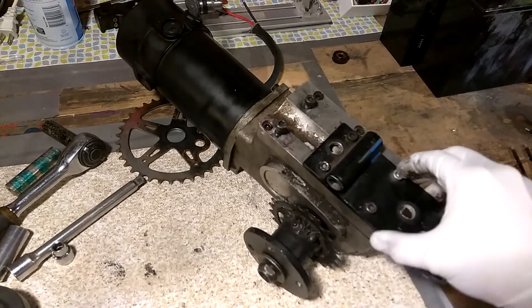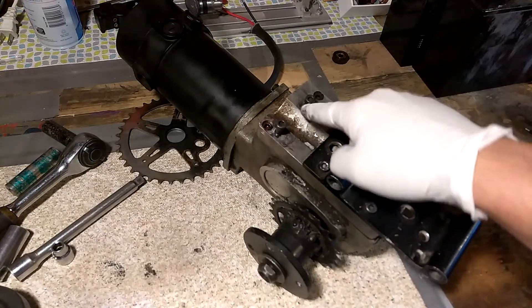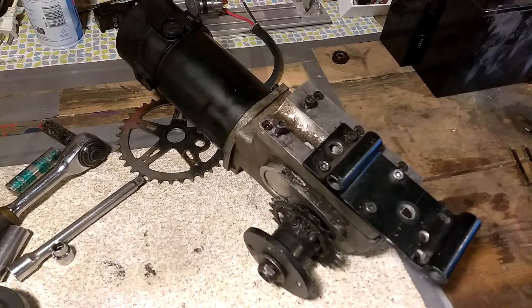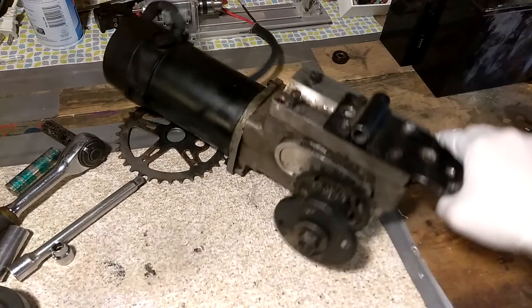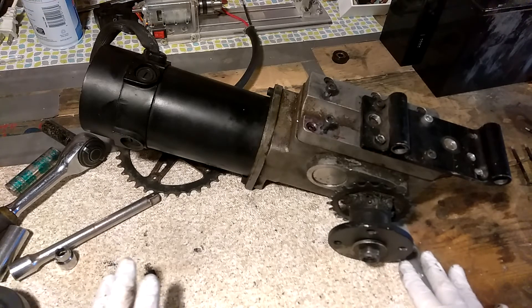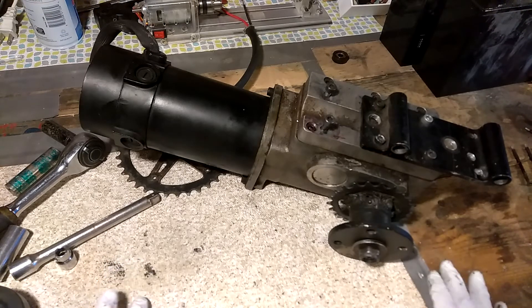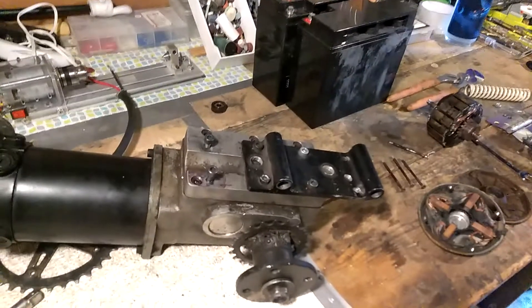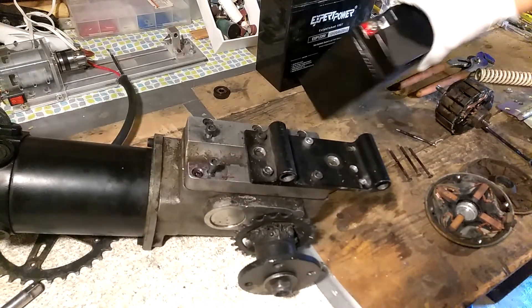This should be a good thing to bolt in — I've got these brackets right here with bolt holes evenly spaced, so I can move it forward and back as needed to mount it up. This will significantly reduce my range because it's 500 watts, but I'll gear it up so it can go faster and run it at about half power — I should still get close to or just a little less range than I'm getting right now.